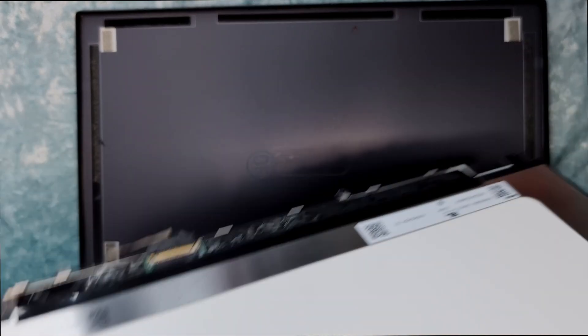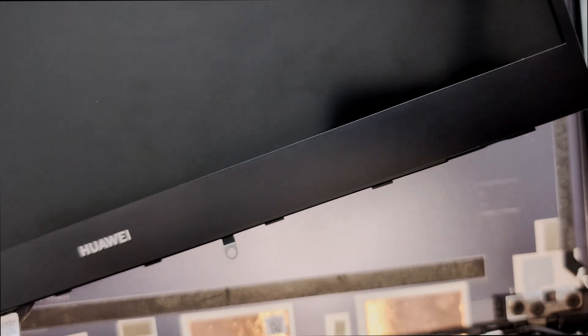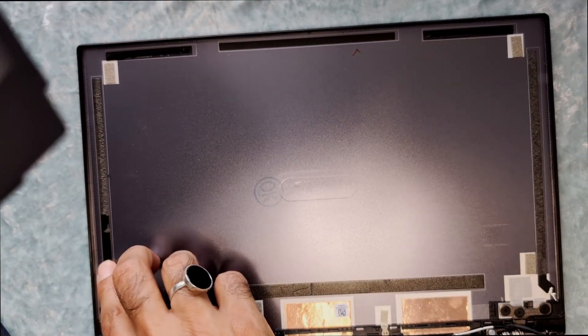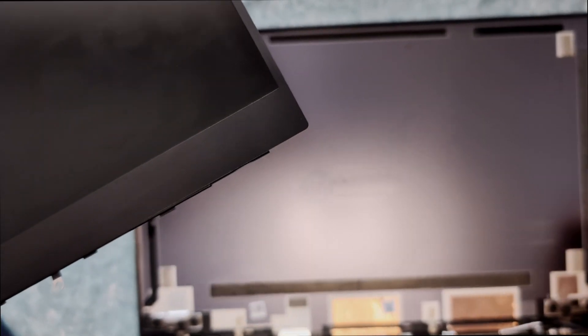What I've done is applied double tape on the top cover, then placed the screen because it's easier to apply it first and then install on the back cover. You need to make sure these corners match properly and sit properly on these corners. If you can match these properly, then it's going to be easy to make the screen sit. You can also apply extra double tape on the back as well, because the only thing going to hold this screen is just these two screws. So maybe it's better to apply some tape here as well. I'm going to apply some here and then place the screen and move to the next step.